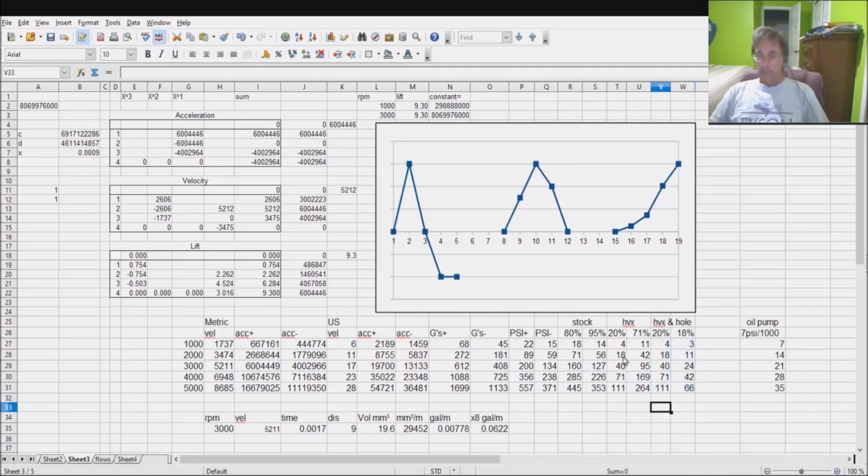However, if you look at these oil pressures, this is when you slice open your lifters, those pressures don't get improved, and they absolutely suck relative to stock. And these pressures are the ones that control your lifters. So you can always pop open a valve cover and change your top end. If you blow out your lifters because you've done this, well, then you've got to do a complete teardown.